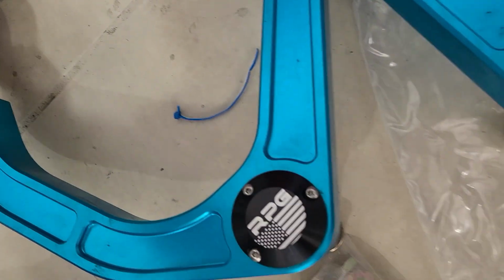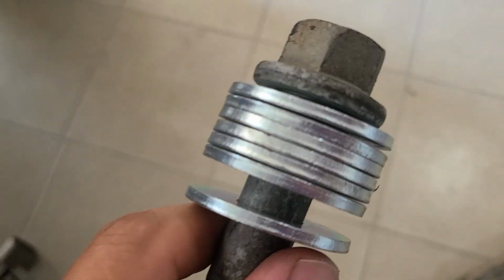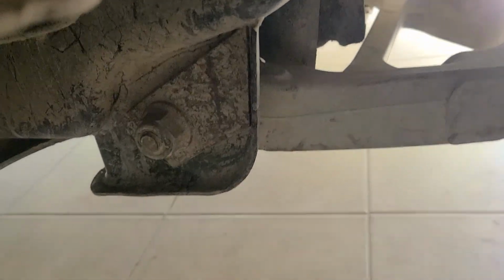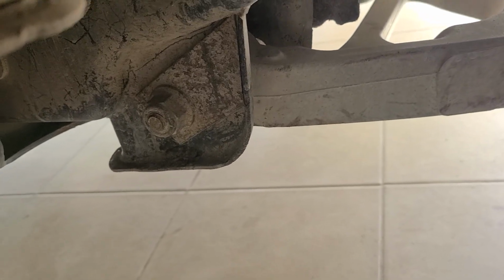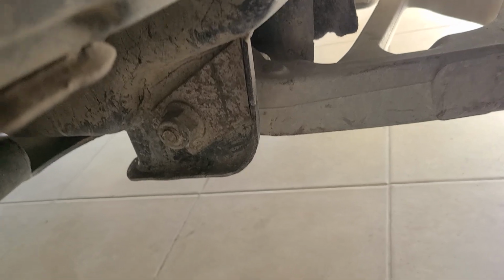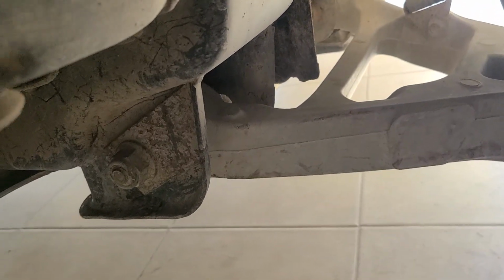because the lower control arms tend to slide out on the slots when you hit big bumps. We're going to get these big steel washers here, and we're going to weld them at the end here. So I've got a piece of steel that was sized perfectly to jam in there, so it's jammed against this lip, so the lower control arm can't slide out. But the washers are going to be a permanent fix, so that the alignment can't get out when this thing does some big jumps and stuff.